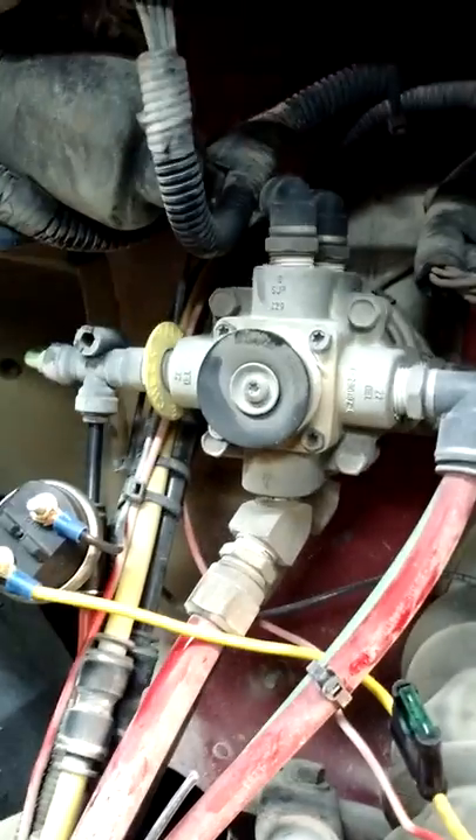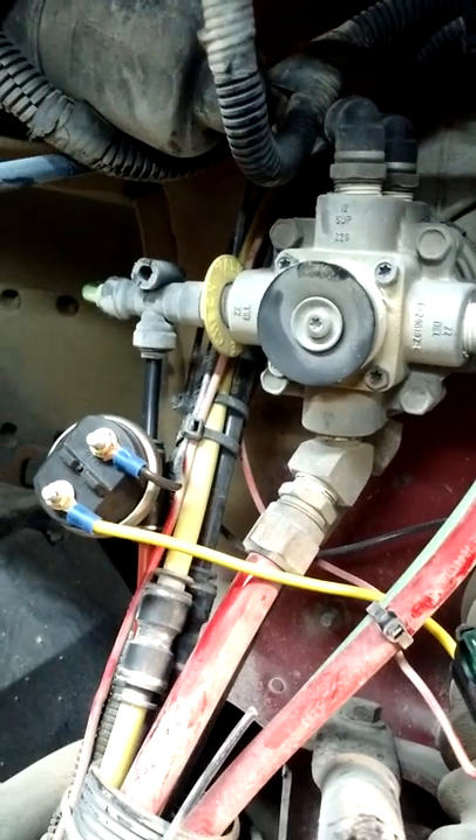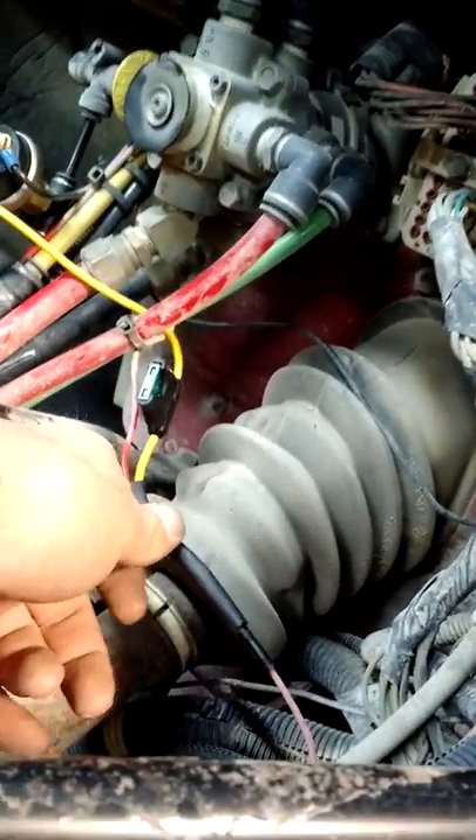That was pretty simple. To figure out which line to put it on, I just disconnected, stepped on the brakes. On the M2 model, this is the line — it's actually red going into there. I had to add a little bit on, which is black. Powered it off of the box there, came right into the main stud which also feeds the brake controller. I got a relay on there like you're supposed to have. For the brake light switch, I added an inline fuse just to make sure I didn't have any issues there.